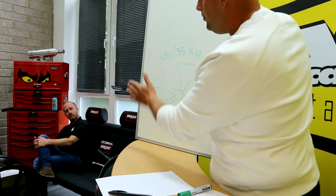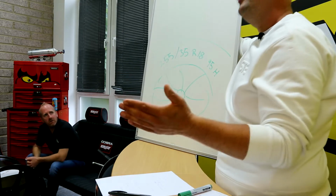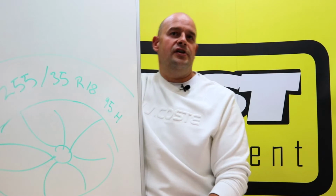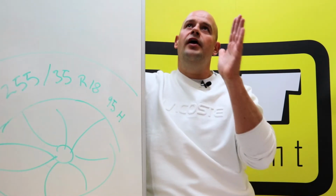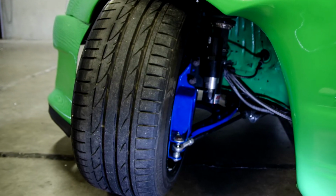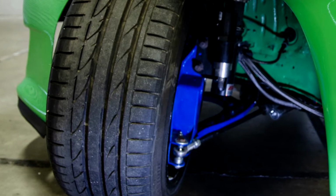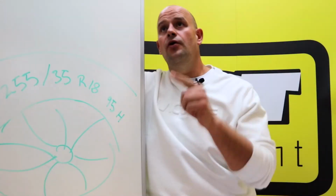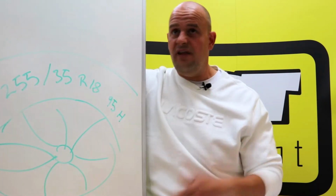I don't know about you, El, but do you always get asked, I know I do on Fast Car, where do you buy a stretched tyre from? And you don't buy a stretched tyre, you stretch a tyre. So this is essentially buying a tyre that is not wide enough for the wheel and then stretching it on. So for instance, if you're buying a tyre that's designed for an 8-inch wide wheel, but you're putting it on a 9-inch wide wheel, and people take this to the extremes and they can put them onto 11s.